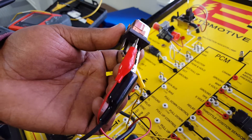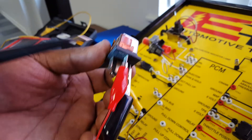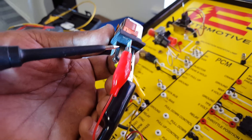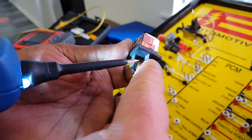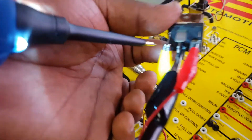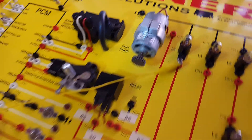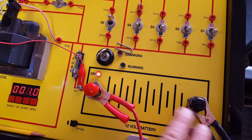What we have here is a relay. We're testing this relay and we have number one battery power coming in right here at pin 30. Pin 87a is our yellow wire right there. We're taking that and it's going to this load here. The bulb is not on — we are connected with a power probe here.